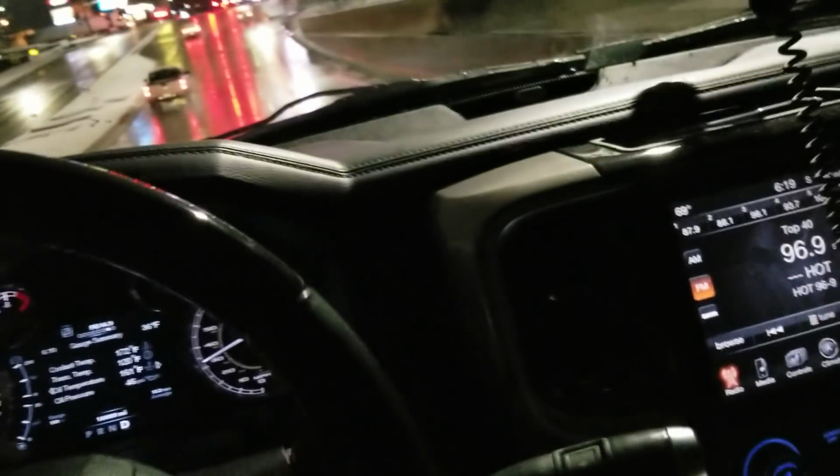So we got the oil out of the way. Then we've got the combustion chamber. Now this starts leaning towards idling your truck in cold temperatures as well. Why do you think these things have automatic high idle? The computer registers the fact that it's not staying warm, so it kicks in and makes sure the combustion chamber stays warm. Guys, just stay with me. This leads back to what I just talked about a minute ago: your cylinder wall is getting washed out.